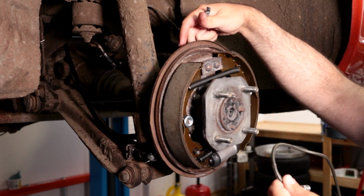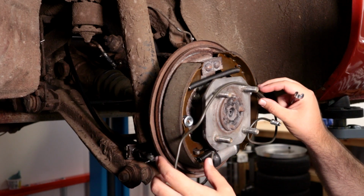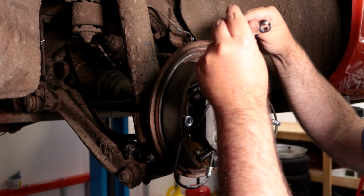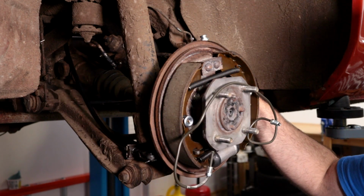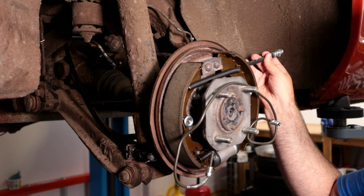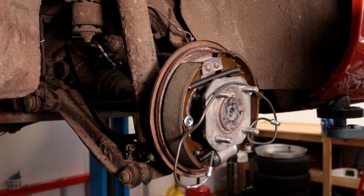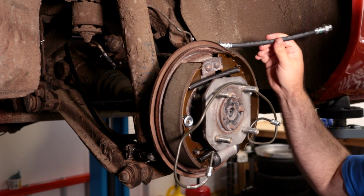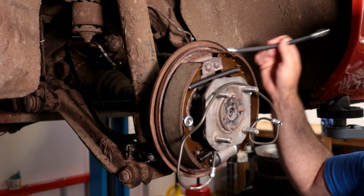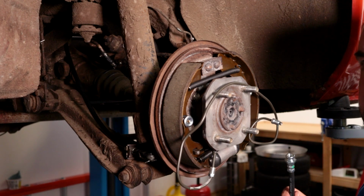This goes into the back of the wheel cylinder. This loops around. There's a hole back here that will meet into the rubber line, which, because I will be doing a more substantial brake upgrade in the future, I just got factory brake lines. Basically one end goes up here where this hard line comes down, and then it bends into the back of the bracket on the caliper. So not really much to see, but I will probably start with getting the hard line onto the rubber here, and then that'll let me get this installed and get this back onto the back of the wheel cylinder.